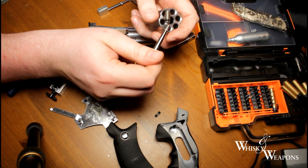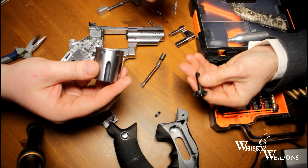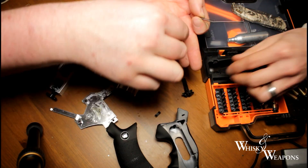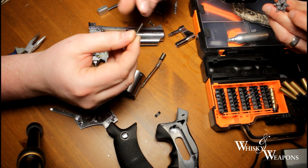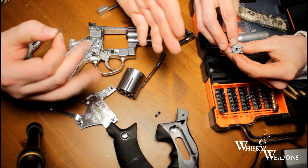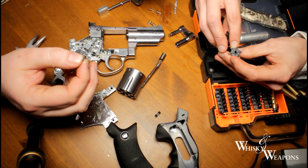It's a left hand thread with a spring - we'll not forget that. So it's located... we've got another spring in here that goes in the bottom, and there's a pin too. We're getting more and more here - this is the first time we're doing this. Comparing the old and new ones - yes, you probably won't be able to see this on camera, but there's just a little chunk missing. That was causing it to jam because it wasn't indexing right - it was stopping the pellet in the middle. That's literally just a tiny little chunk off there.